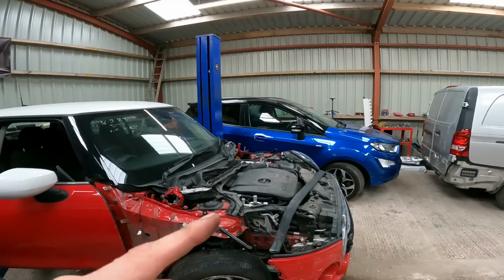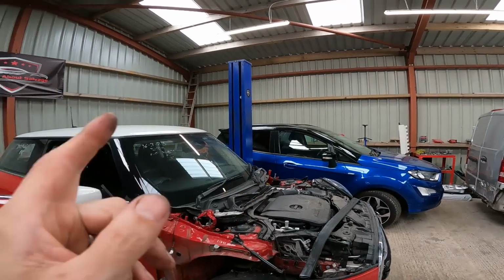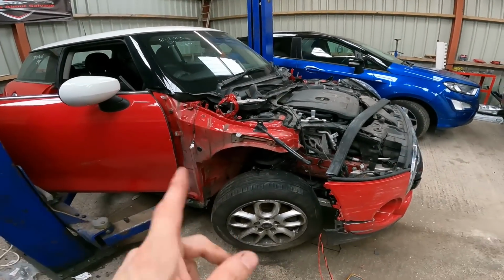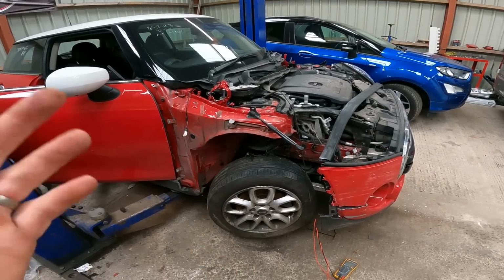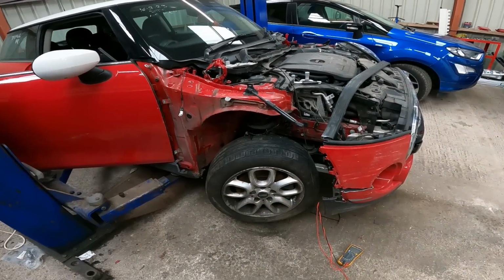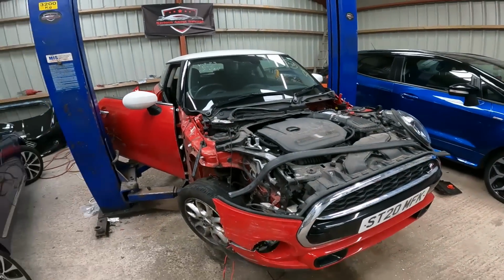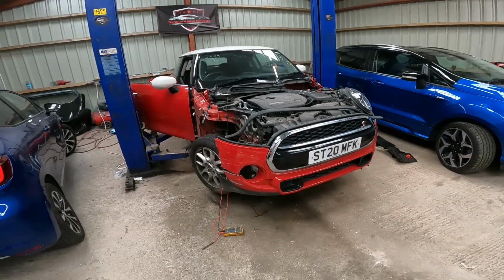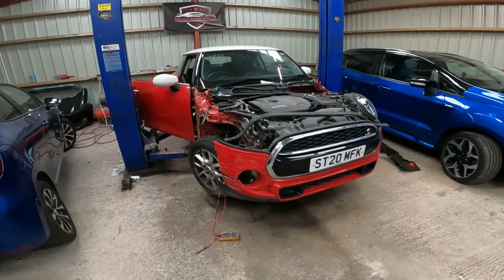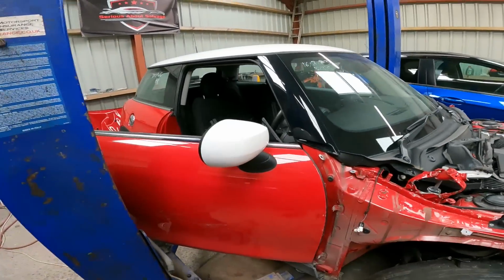and in the end I took the passenger side one off that I know is working, because I've had the wheel speeds up on the computer and spinning the wheels. I put it on this wheel and it works on this wheel. So yeah, I have a dead wheel speed sensor, and with this being automatic, I'm pretty sure, I mean, you look in transmission errors and it says wheel speed sensor. It's also got one for adaptation values not completed, but that's something that happens during your driving. It adapts to your driving style.